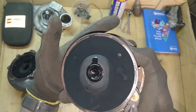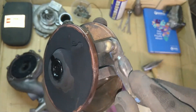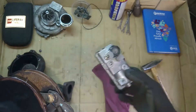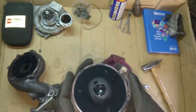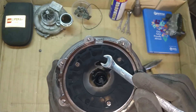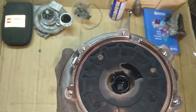Let's have a closer look at this. So this actuator arm here is the one that's driven by this actuator, and this is electronically managed by the engine control. So that variable vane system is what controls these little vanes in here. Typically, this is what manages your boost, for lack of a better term.